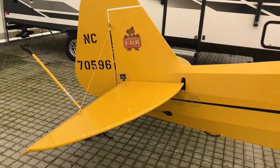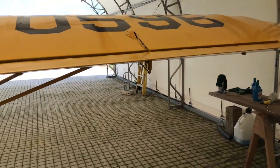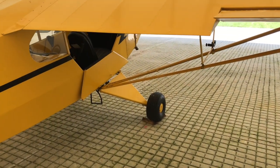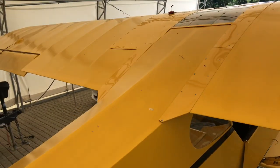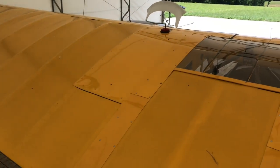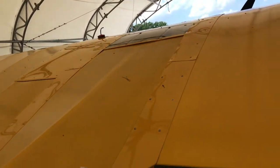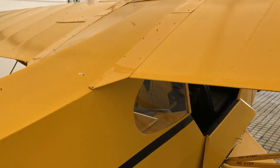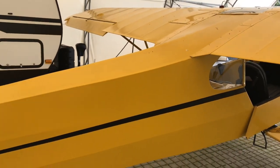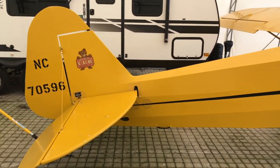Rear part of the fuselage was replaced with new steel tubing. The wings got redone, and they're basically new wings. We have sealed struts, painted fabric, and then the previous owner added the wing tank STC on this airplane, so that gives us 10.5 gallons usable in addition to the 12 that it has up front. So that extends the cross-country capability of this airplane by giving you a good amount of time that you can be aloft without having to run and duck for fuel.